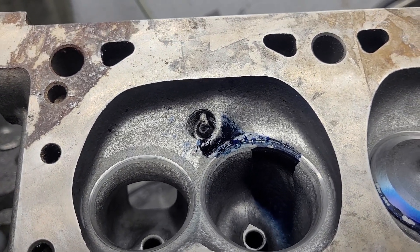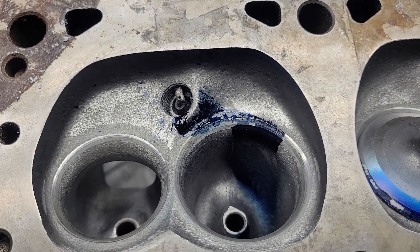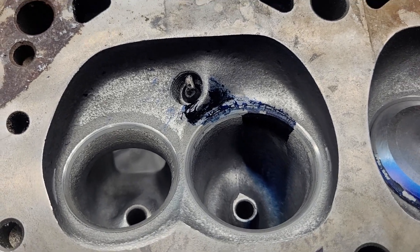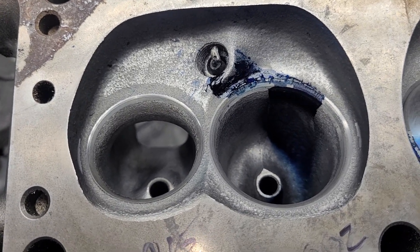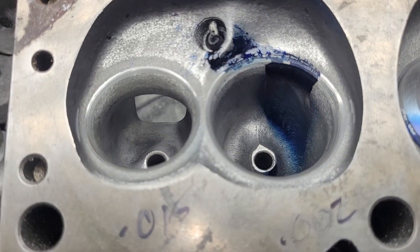Back on the Magnums — they got their first cut. I'm hoping I don't need to do a dozen cuts on this to get it where it needs to be. Remember, it's only a 400 horsepower project, and I'm better off achieving that 400 horsepower with a smaller port.